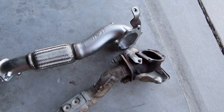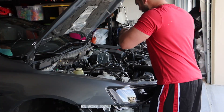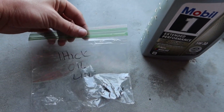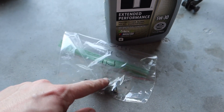First things first, make sure all my tools are out, everything's clean. What we're going to need to do is find our bracket, place our turbo on there. Just be really careful with all your lines — you don't want to bend anything. Here is our turbo, and our bracket was right underneath it. Now that the turbo is positioned where it needs to be, we're going to take that oil line that goes into the pan and coat the o-ring with new motor oil — 5W30 or whatever you guys are running. These bolts are from the Rally Art and we'll be reusing them.